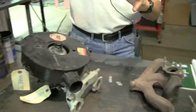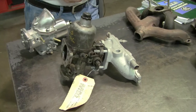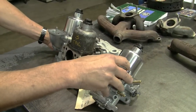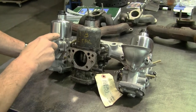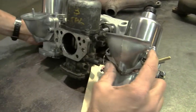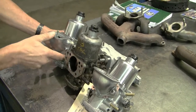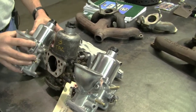When you pop your hood you'll probably see something like this — a carburetor with a dashpot sticking up. Pop off the air cleaner and they all look pretty much the same. The easiest way to tell the difference between an HIF 44 and an HIF 38 is the angle where the air cleaner horn comes down. The HIF 44 is kind of square; the 38 has a rounder air cleaner lid. Other than that the dashpot, throttle linkage, and everything else is about the same — it's just the air cleaner shape that differs.